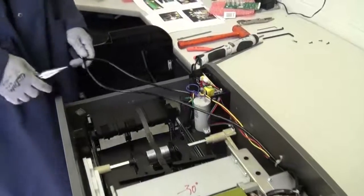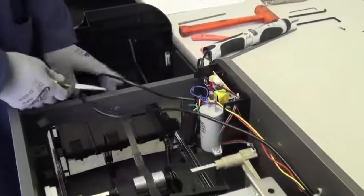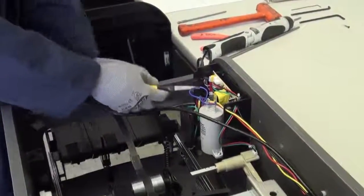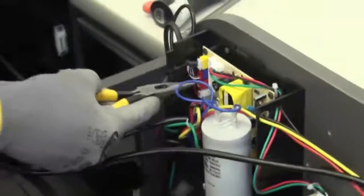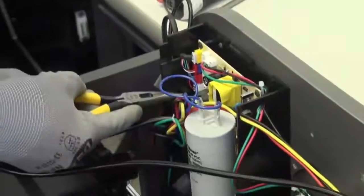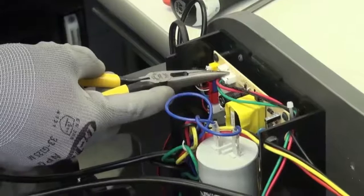The next process is to remove all the cables on the main PC board, starting on the left top hand corner and disconnect our bin full, our two auto start sensors here and here, our locking solenoid, and go ahead and disconnect our tachometer wire.